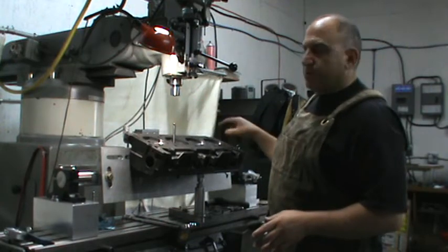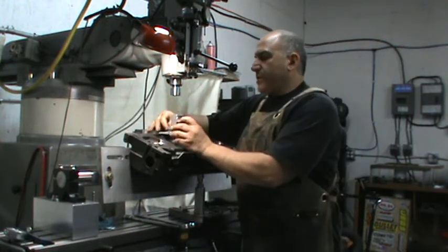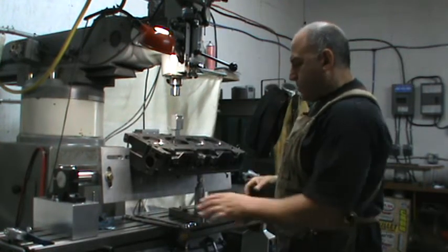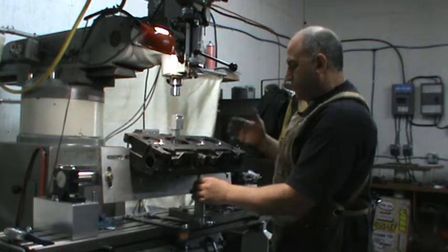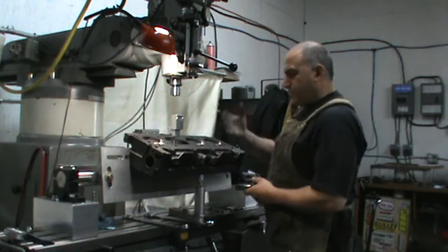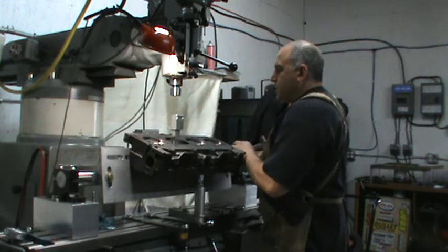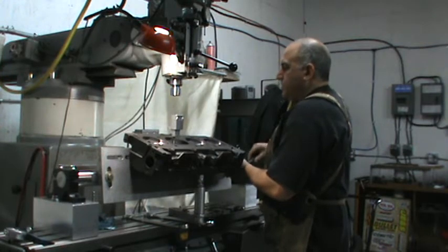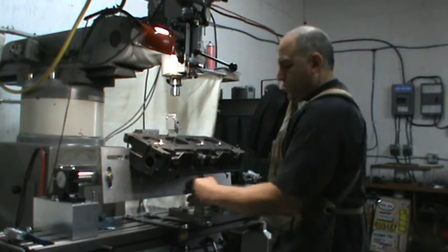No tool changes either with my system. Before, you had to swap out a coaxial dial indicator or a dial test indicator to find center after you leveled it off — that's gone. So I grab my digital level sensor block holder and check my numbers. I've got to move it a little bit. I always adjust this axis first and then that axis, because the stand will prevent me from doing it any other way — just common sense. Always adjust this way first. Loosen this up on both ends. I'm watching my digital level — it's got to come up a little bit on this end. Looks like a good number. I'm going to adjust it up this way a little bit.